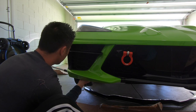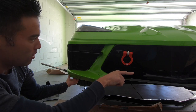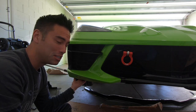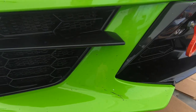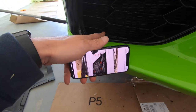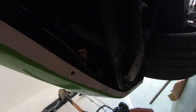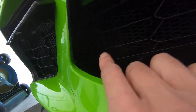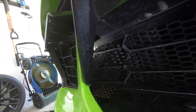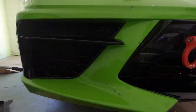Just pull it up towards the front of the bumper — that was pretty simple. The front brake duct grill slides in to the right first, and then this one slides right up next to it. Online in their instructions they show exactly where to put all the zip ties: two go right behind here, and then three more — one here, one there, and one there. For the front brake duct grill I put two zip ties, one there and one there, keeping them loose until I get the other grill on.